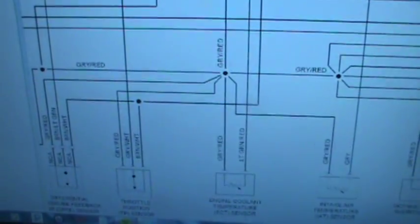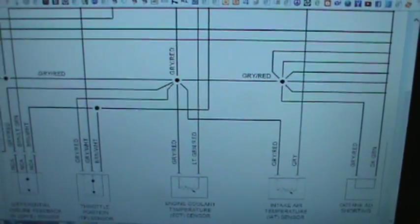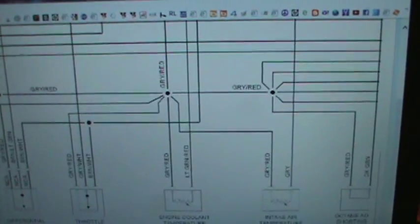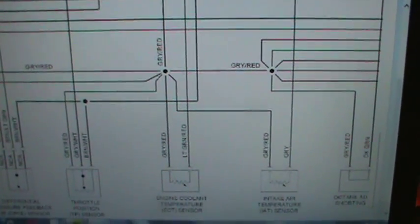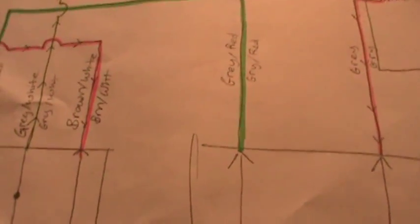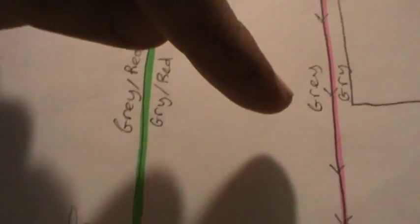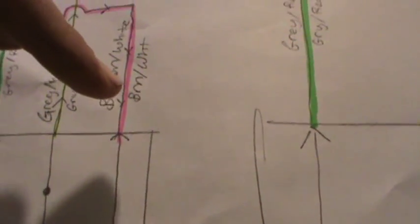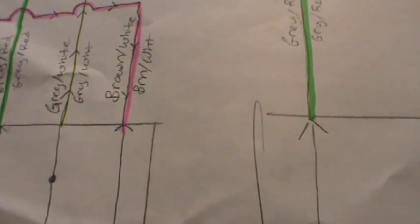But if you're looking at this wiring diagram, and if you understand what I just told you — the difference between those two types of sensors — because I showed you one has an internal resistor, like the engine coolant temperature sensor and the intake air temperature sensor, which are both thermistors, they cannot share that same five-volt reference. Because think of it: if you had this five-volt reference right here, which is actually the sensing circuit and the signal wire, if this is pulling the voltage down, it's going to pull the voltage over here down also, so you can't do that. They have to have different five-volt references.